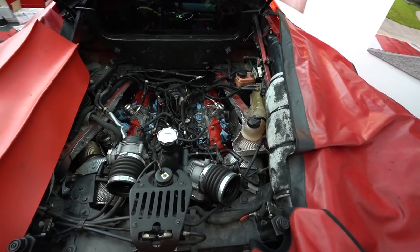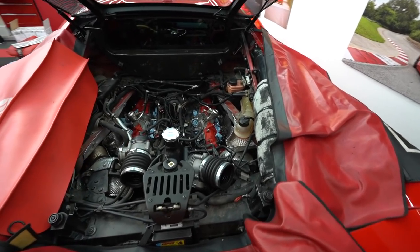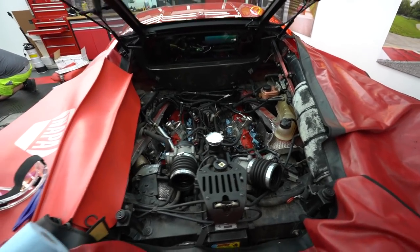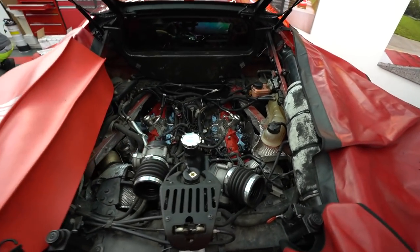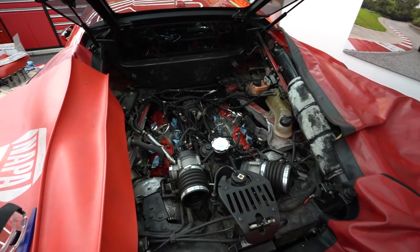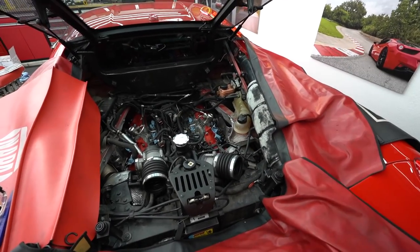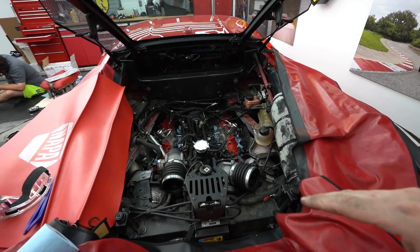We are all done — all eight cylinders cleaned! That was not nearly as bad or as scary as I thought. It does take a while because each cylinder takes a couple of minutes and then you have to recheck it. Have a cell phone, mirror, and flashlight handy. The plastic scrapers were definitely key: scrape the big chunks first, blast it, scrape again, blast again — probably two or even three rounds with the walnut blaster to get it right. The valves look incredible — I can't wait to start it up and see if we picked up any horsepower.